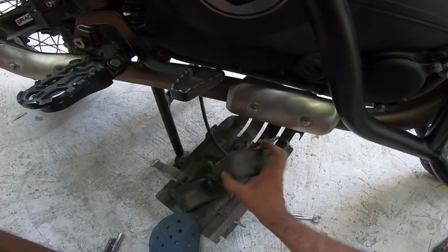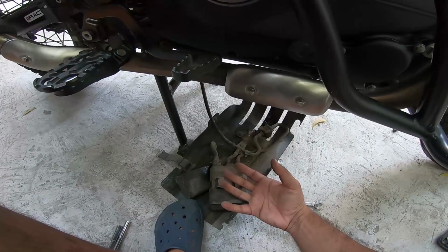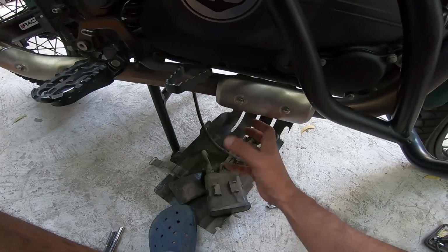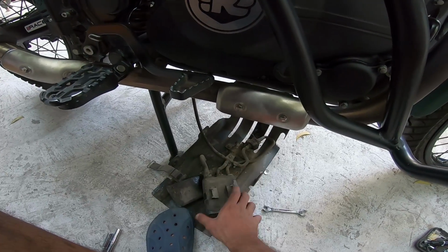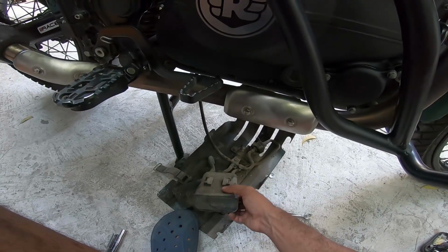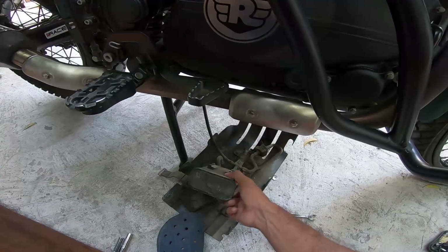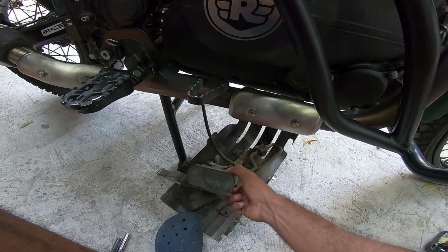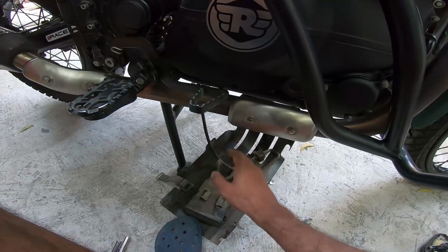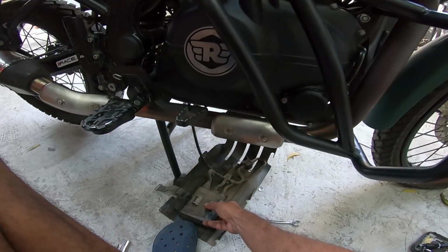If you can't hear anything, if this is a solid block, that is, you ought to be able to hear charcoal particles inside. There are these beads of charcoal inside that ought to make a shh kind of a shaky noise. And when that doesn't happen, you know for a fact that your evap system has been clogged for a really long time. So this is just a solid block now, and it's best to replace it almost immediately. If you do not want to replace it, I have an alternative for you.